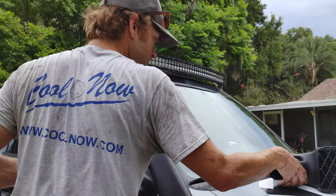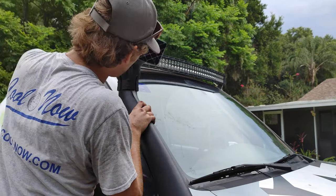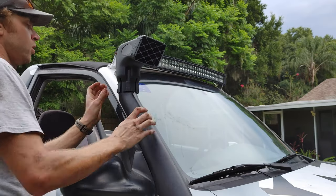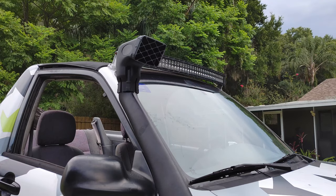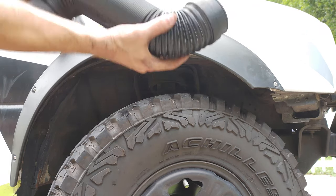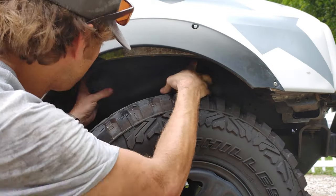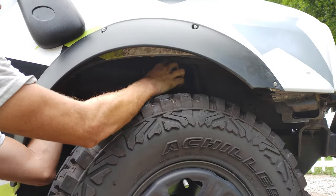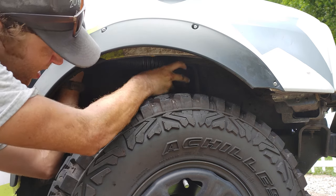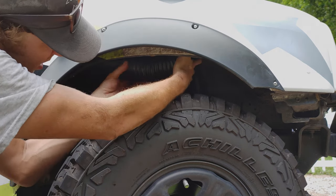We'll install the top inlet piece — this needs a band clamp that comes with it, black in color to match the tube. The piece of flex pipe makes a pretty nice S-shape to go into the snorkel and then into the side of the piece that passes through the inner liner into the engine bay. Once that's on and sealed, the snorkel is pretty much installed.